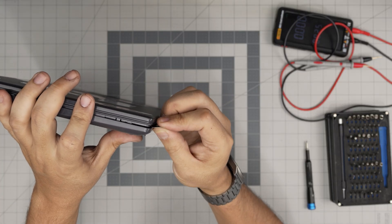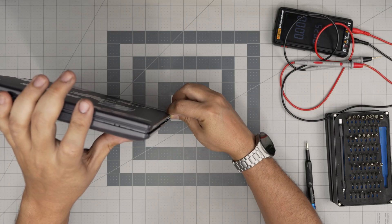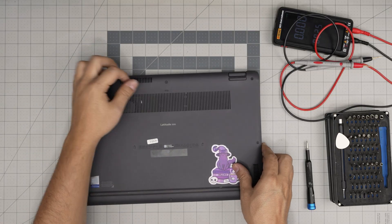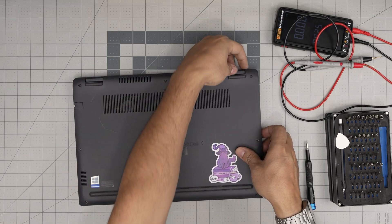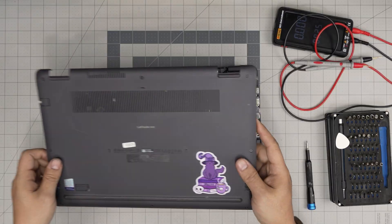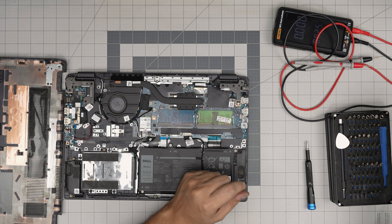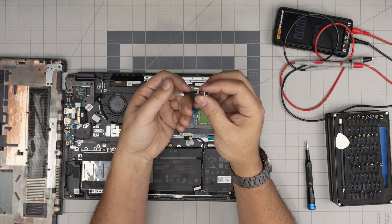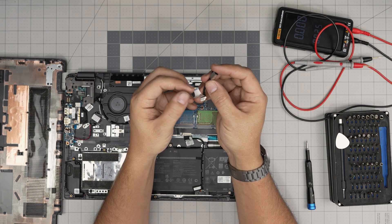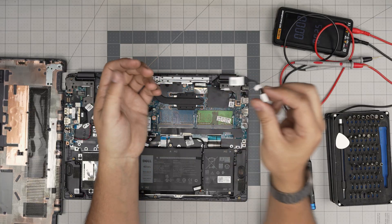On the front end, stick it there and just rotate — you want to stick it between the palm rest and the bottom cover. Once you do the front and the back, just grab it, put your finger in and wiggle around; it will release the rest. And there's the bottom cover. I did order a new part — this is the power jack connector; it has 3M tape right over it. I'll leave a purchase link for you guys.